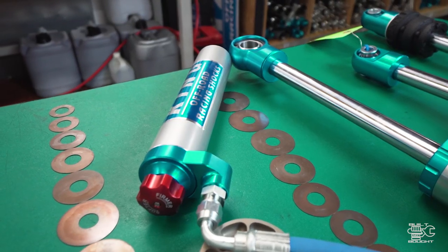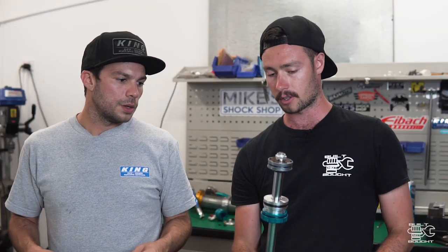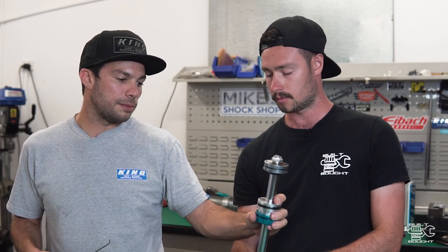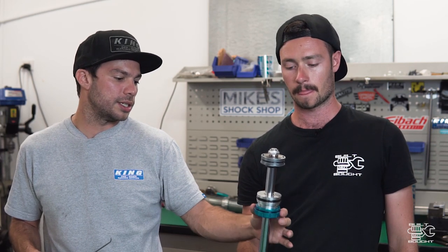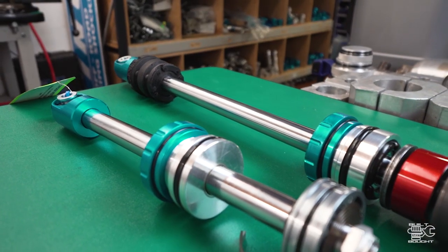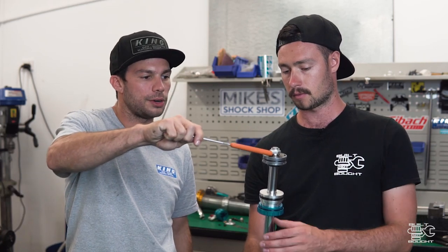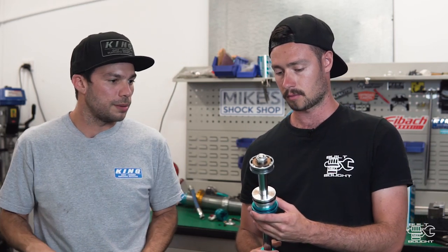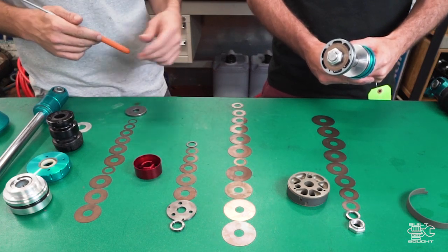This is the assembly out of it - that's the centre of what's in it, exactly what's inside. So when the shock goes up and down, this is attached to the cylinder. This is your seal carrier or seal housing and this is your wiper cap. This is the part of the shock absorber that's responsible for all of the control. Your top row of shims on top of the piston controls your rebound stroke - that's as the tyre and wheel fall away from the car. On the underside is your compression stack - the shims for your compression stroke - and that controls the shock absorber as the wheels compress.